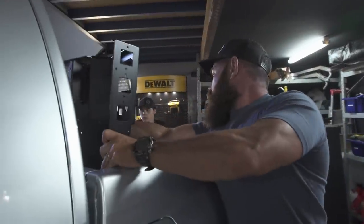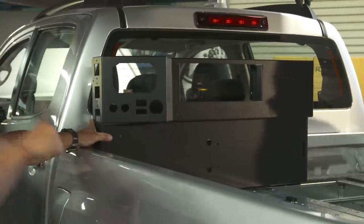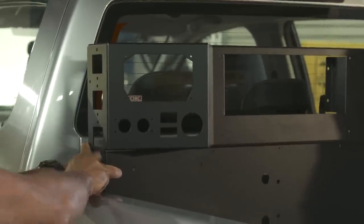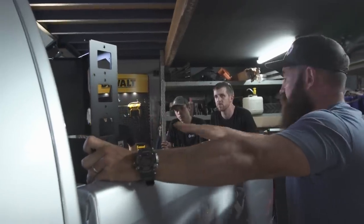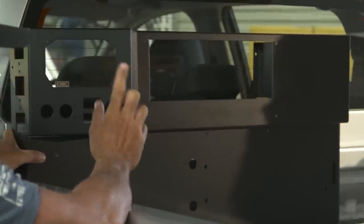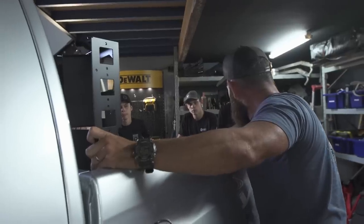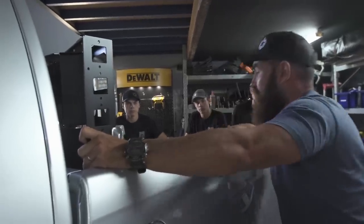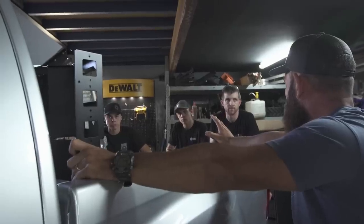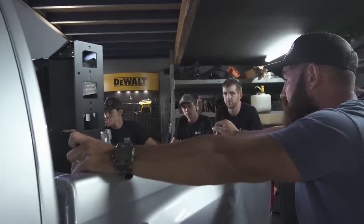Where this is mounting, Joe, it's pretty much in that position right there. When you open the canopy door, you've got access to all of the power. All your breakers are gonna be on the side there. That's gonna be a really nice, neat install and doesn't impede on anything at the back. If you can pre-wire everything, have a quick catch up with Sam about where he's at. The battery's gonna live in the back here. We've already run all of that through, and the canopy is going to be self-sufficient. There's going to be no interaction with the cab on this build, which should make it a little bit easier, but there's a fair bit to go.